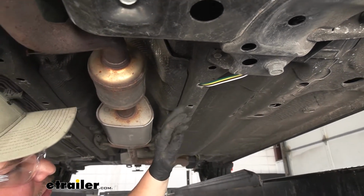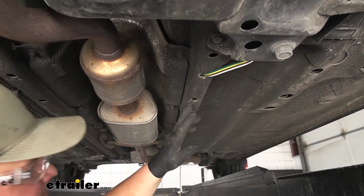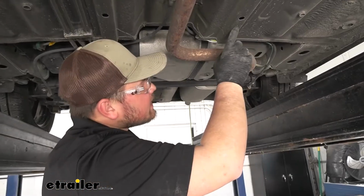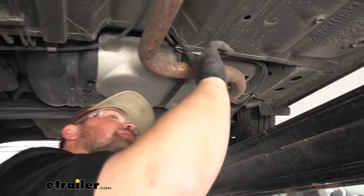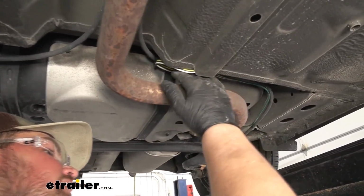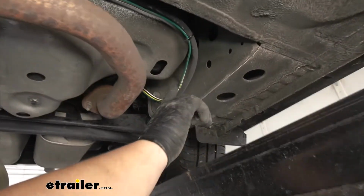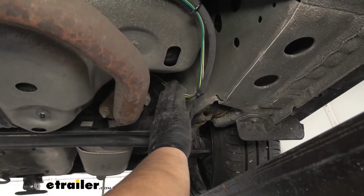There's actually going to be a channel. You can just push the wire down the channel. So that wire is going to come all the way down this channel. So it comes out of our channel right here. And I just zip tied it up to our parking brake. There is enough clearance with our exhaust to not have to worry. So then I just zip tied it to our parking brake and then up this way.